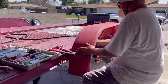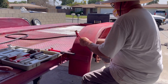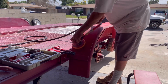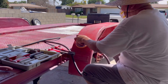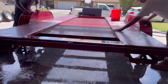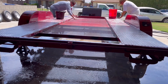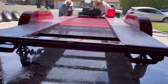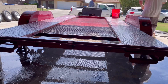This time we used a green Scotch-Brite pad. All the sanding gets into the little grooves, so blowing it out with compressed air helped, but we decided to wash the trailer one more time for a final degrease before getting it ready for paint. Any accessories like taillights and trailer hitch accessories I either removed or masked off — anything I didn't want to get paint on.